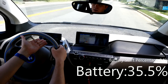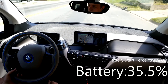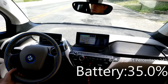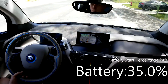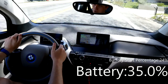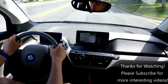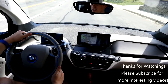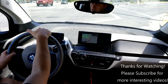So as you can see, in about 11 miles of going up and down a hill, I've been able to recharge the battery about 12% or so — that's about a percent a mile. You probably wouldn't want to refill your entire battery pack this way; it just would not be worth the time. But if you wanted to recharge your car on the go because you didn't want the battery at a super low state, it's entirely possible to do with that range extender. You're pretty much always going to be able to find a gas station. But sometimes it might not be practical to find an outlet, and if you're in that situation, there are options — at least with this range extender version car.